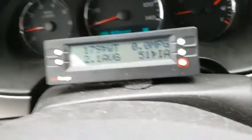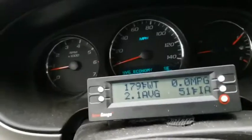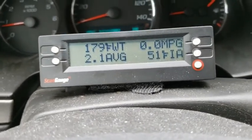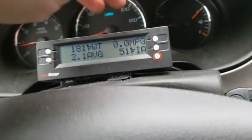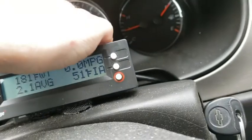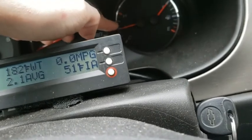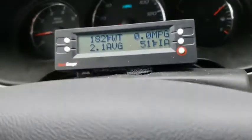These plug into the OBD2 port - it's always plugged in to read the gauges. It basically reads the sensors that your car already reads, but your car doesn't give you a display. For instance, I already have a water temp gauge up here but it's just lines - high and low. This is telling me it's 181 right now. Normally it's a bit higher; I just drove a mile and a half. It usually goes to about 202.